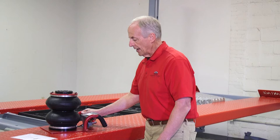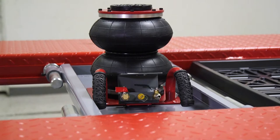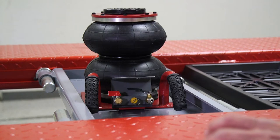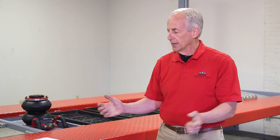The nice thing about this jack is it's very versatile. I can use it on the runway, or on the floor if I need to get a car off the ground. I can also put this right inside the jack tray that comes with our lift package and now I have a crossmember lift point. I've got a '72 Corvette — I like to pick up at the crossmember — I can put this in and pick that up. I can then put a jack stand on each side, lower it down, and have it on jack stands to take a tire off. It's another great option to use with your lift.